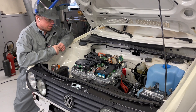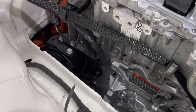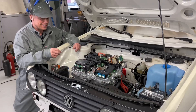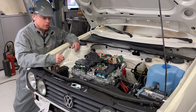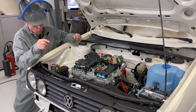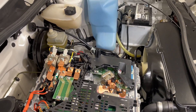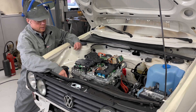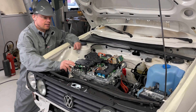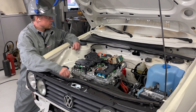As you've probably seen, I've done a lot of work this week. I wired everything — including the low voltage part to the Nissan Leaf motor — which took some hours. The gas pedal wire was in the socket but not clicked in, which is why the motor didn't spin at first. I also finished up all the cooling system, only missing a small hose between the expansion canister and the radiator. The water pump is connected and tested, but I haven't tested the radiator fan yet since I haven't run the car up to temperature — that needs to be done later.